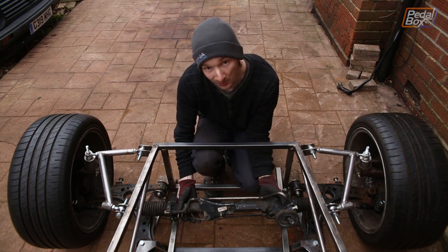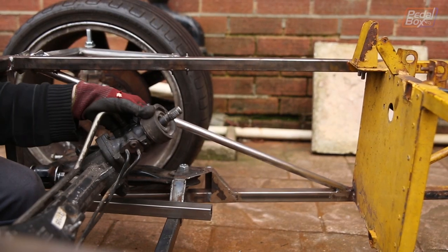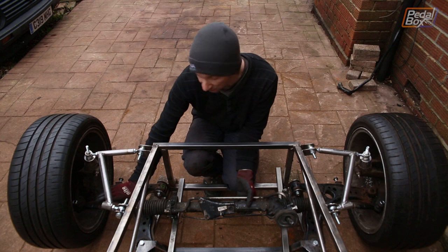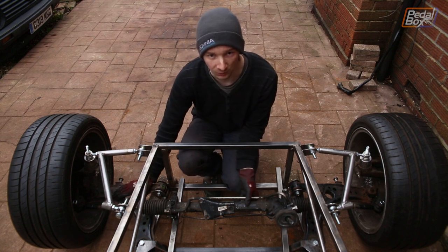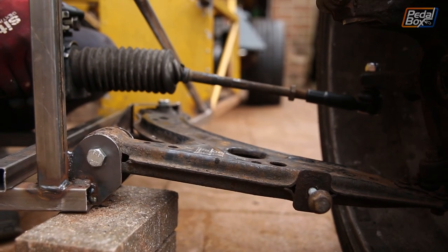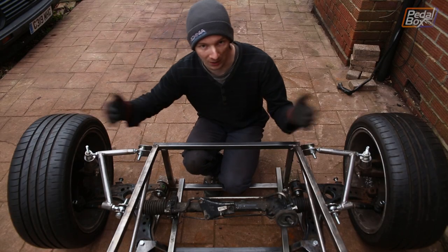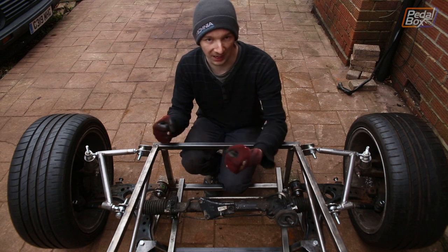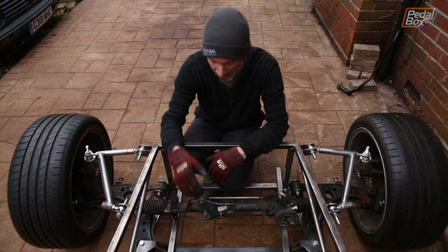We've also got to lift it up a little bit. The reason we need to do that is our lower suspension arms at rest, which is roughly where the body is at the minute, actually droop ever so slightly, and we need the steering arms to be roughly parallel with them. If the lengths are any different, we get a similar behavior to suspension arms of different lengths, where as the suspension travels, the end of one moves kind of in or out relative to the other. It ends up adding additional steering angle to the wheel, so as the wheel compresses it will also toe in or toe out, which we don't really want.